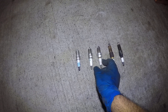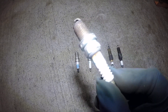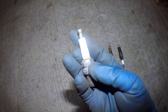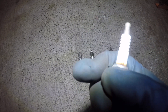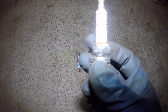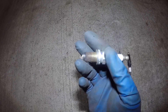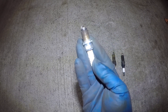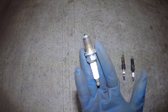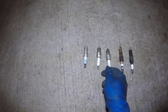Then we have a plug here at 60,000 miles — when I see this, it's time for the plug to go. 60,000 miles is a fair amount of time on a spark plug. You can see the coloring right there; that's not damage, but it usually gives you an indication of how old the plug is and what kind of heating it went through. This plug is at a perfect stage to change — it's time for this thing to go.